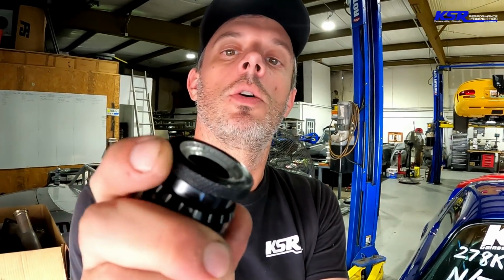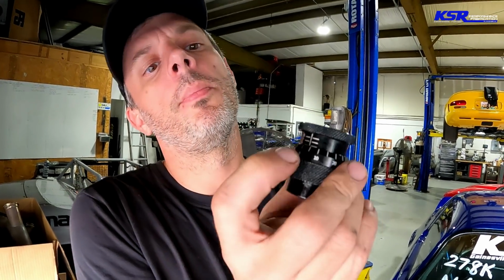I've got something else trick to show you once we get all of these springs swapped out. But this is the tool we use to check the spring heights, and you saw it was compressed a second ago there. So it's got a little indicator on it, and you can turn this and adjust it. See, it's got a cut for the valve spring retainer. So we're going to assemble that into where the spring would go to actually check the installed height, and then I measure the springs to verify what we kind of already know, that they're weaker than they should be. And then we're going to install the new springs with a little bit of extra shim in them, and hopefully make more RPM and make more power. Time for me to get to work.